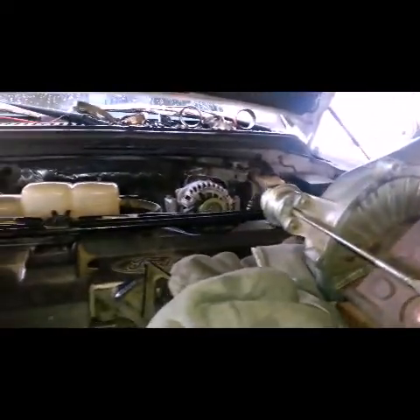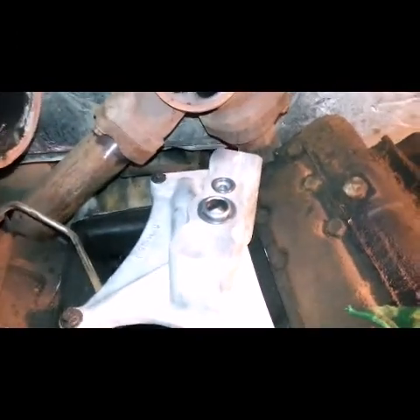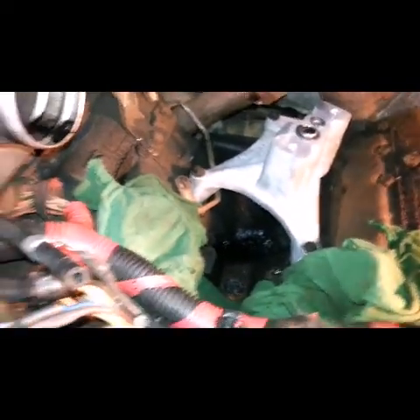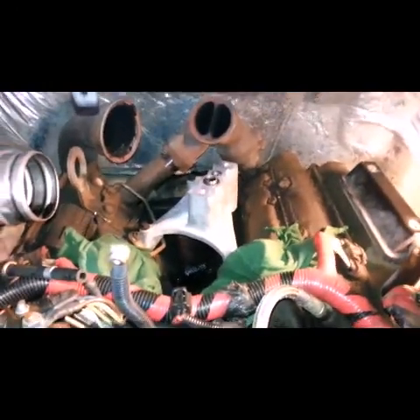Getting everything kind of cleaned up so I can start putting stuff back in. Put the pedestal — a new pedestal — back in. Alright, we got our pedestal back in, everything clean. Two O-rings down on the back on the bottom and then two O-rings right there on top. I'm gonna wait until I put everything back together to wash out my engine, wash off all the oil that collected in the valley. Now just time to set the turbo back in.